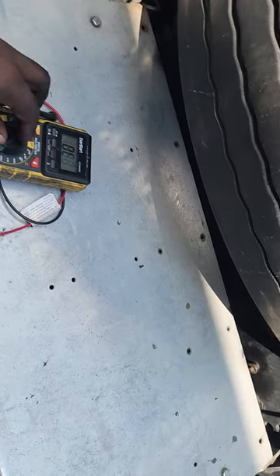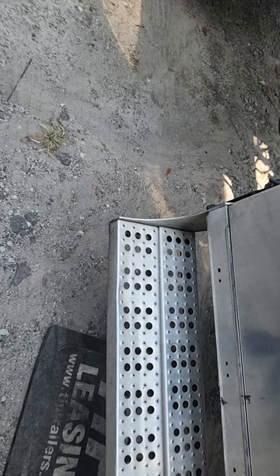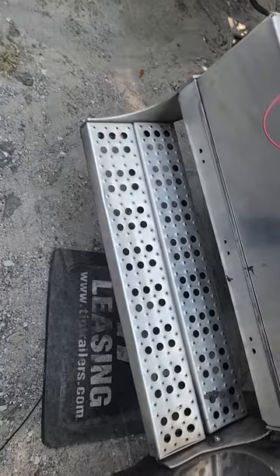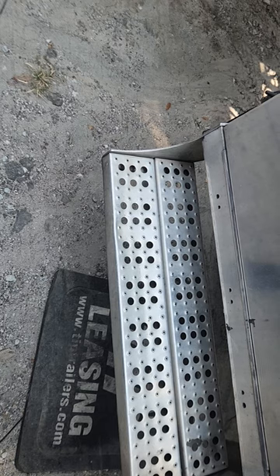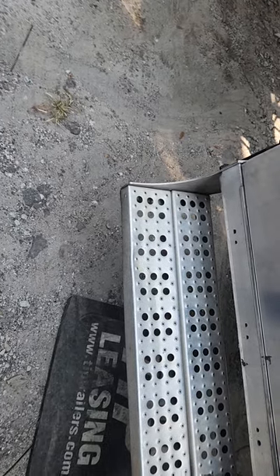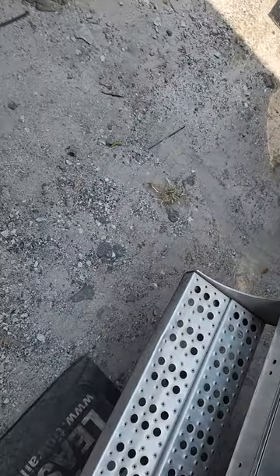You see some videos on YouTube about why your fan stays on, but they don't necessarily get into the electrical side of things. I did have a manual switch in here, but the problem with the manual switch is it's hard to have good AC running while using it, because the ECM is timed to come on at a certain time with the fan clutch and freon to cool it down. You wouldn't know with your finger when to switch it on or off while reading temps all day while driving.